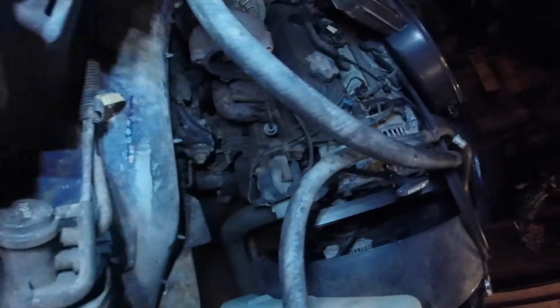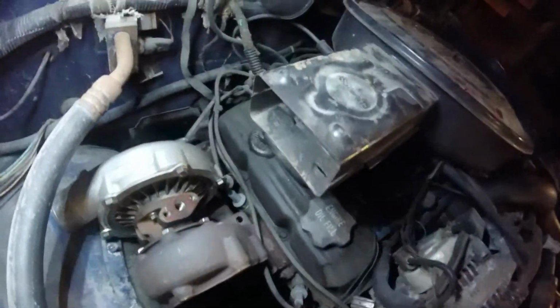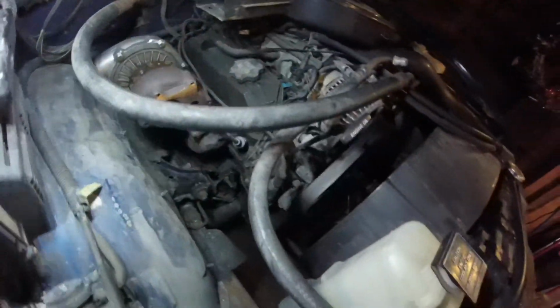And then for the drain, I'll end up pulling the oil pan out and then using one of those threaded fittings that you can get on eBay for like 10 bucks, and then just drill a hole in the oil pan, put the fitting in, Loctite it so it doesn't come loose, and then I'll have the drain set up. It'll be over here on the side somewhere, probably right past that motor mount is where it'll run. It'll be a pretty nice straight shot as long as I can keep it from bumping into exhaust and stuff.